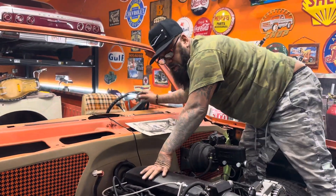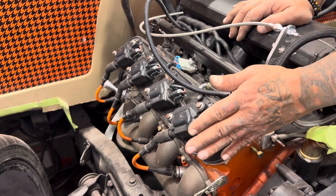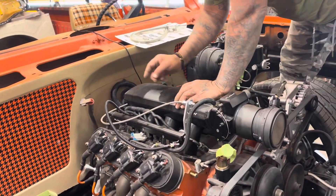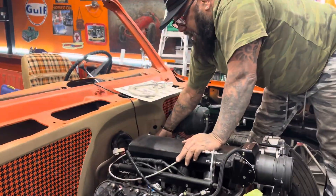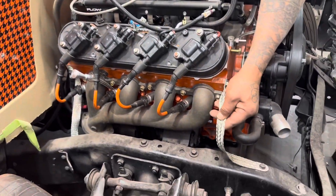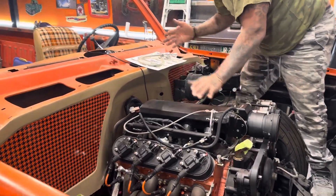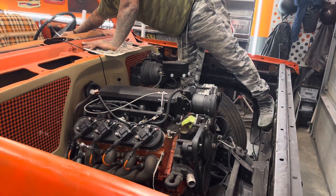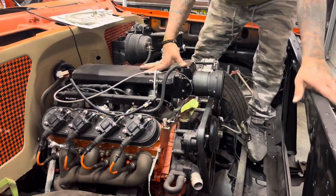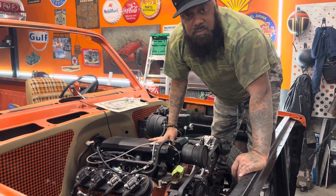That's it pretty much — that's what it is with the standalone. If you mix these up when you're putting them on, it's not going to fire up. Make sure once you've got all the wiring set up with all the grounds — make sure you've got all the grounds, the back of the block and all that. I put on extra grounds because these LS's are kind of finicky. I like using these ground straps. She fires up every time once you get it done. Stay tuned, thanks for watching — hit that like button and keep building!